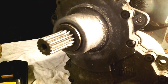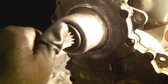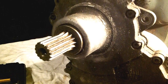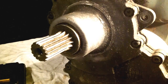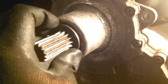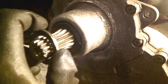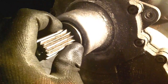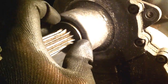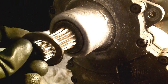On this diamond drive model, the secondary clutch sits on this shaft. If the offset was off, you would correct that by adjusting the washers behind the secondary clutch on the diamond drive shaft. Adding washers will bring the clutch out, and removing washers will move the clutch in.